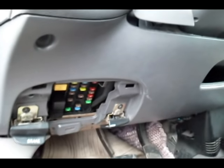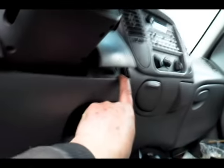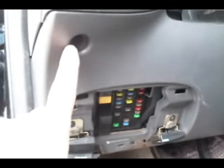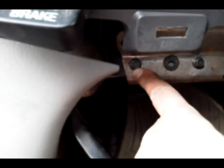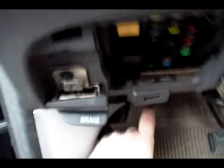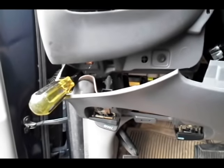To correct myself: there are three little bolts that hold this plastic piece in — one at the top over here, one down here, and one over there. Once you get those three out and pop this piece out, remember there's that little bullet-shaped pin. Before you try pulling it off, make sure you go underneath and loosen the bolts in there — those are actually the next size up, five-sixteenths. So the idea is: pop off the cowling, then take off those nuts and loosen the two bolts down here, which are five-sixteenths, and the smaller ones which are nine thirty-seconds.